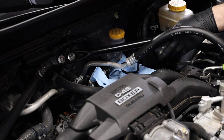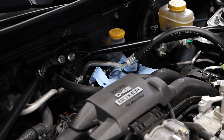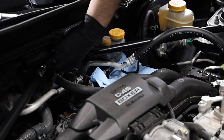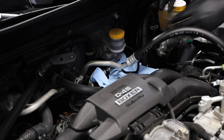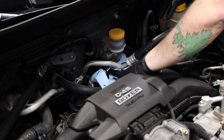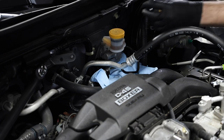I'm going to pull this bar off right here just to give us a little more room. These are 12 millimeter bolts — I'll pull them right off and take this bar off. With the bar out of the way it gives us a lot more room to maneuver, so I'm going to start pulling off that 10 millimeter holding onto the hard line, then pull that clip out and get this line out.